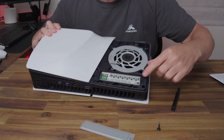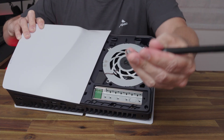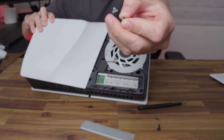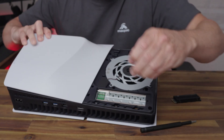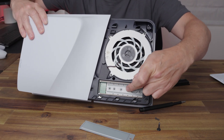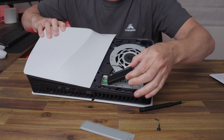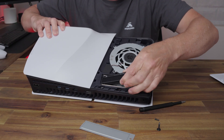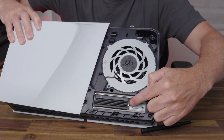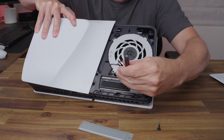In here is where the drive goes. There's a screw at the bottom which you need to unscrew — take that out, along with the little grommet that comes with it. That grommet needs to go into the size 80 hole, which is the fourth hole along. Most cards you get for the PS5 will be a 2280 card. Take your NVMe drive, put it in at an angle — it will slot straight in — then push it down so it sits nicely on top of where that grommet is. Take the smaller screw and simply screw it in place. Done.